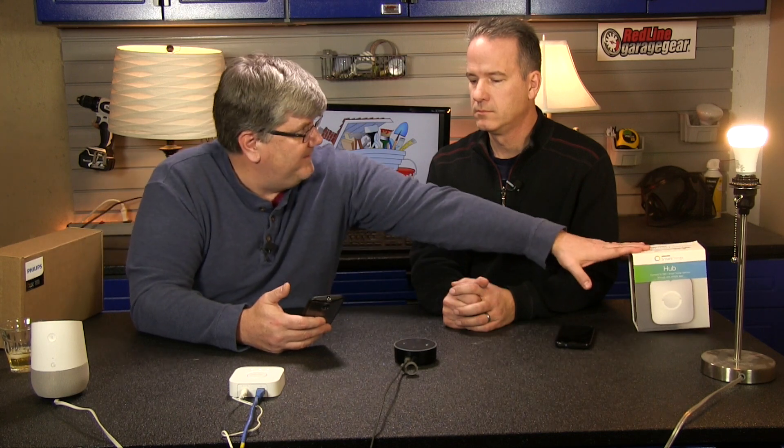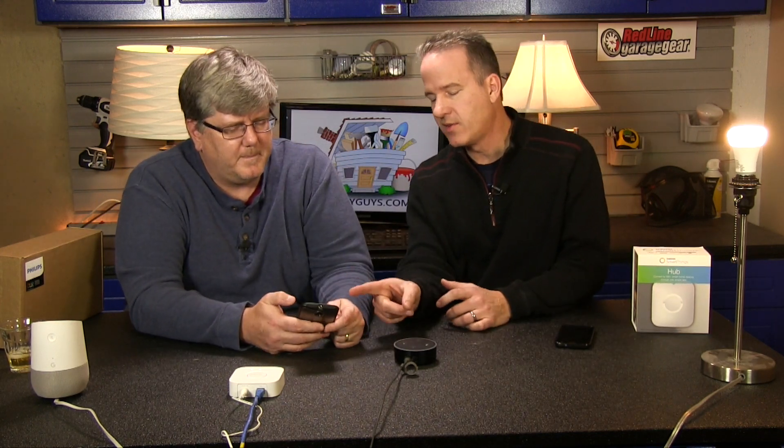One host uses Alexa and the other has the Google Home. So when going into the home control settings for the Google Home device, it says 'add your smart devices to control with your assistant.' Hit the little plus button, and it asks: do you have Nest? Do you have Hue? Do you have SmartThings? It's not necessarily sensing those on the network — those are just default options. So we're going to choose Hue.